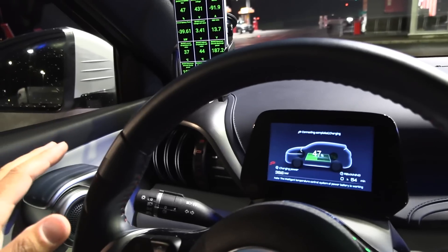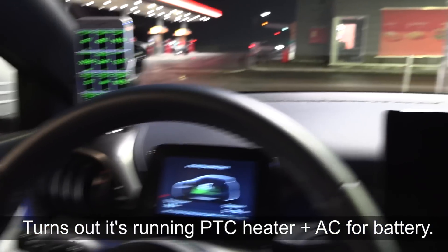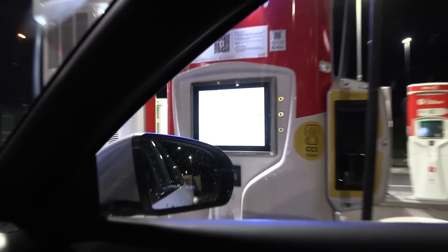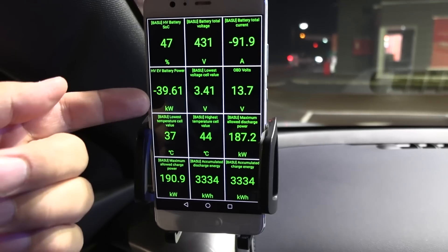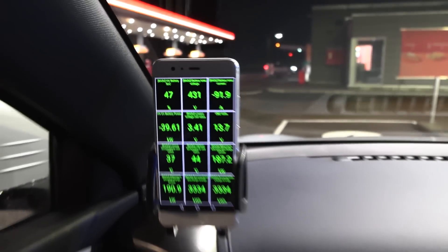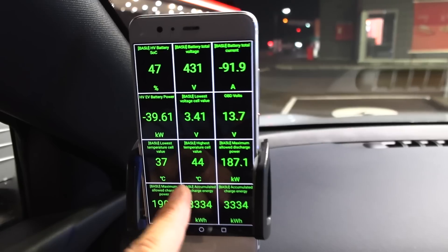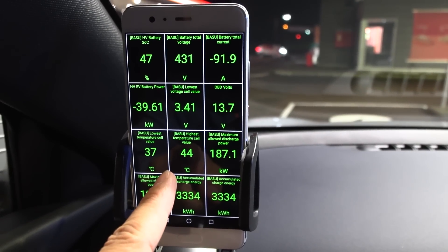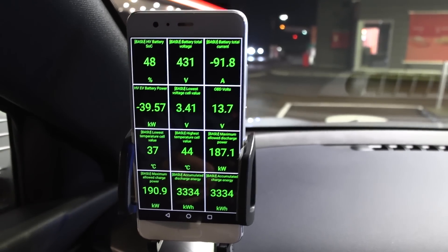We're back. I noticed that it's quite hot in the car now — it seems the car dumped some of the heat into the cabin. I noticed this also during the 1000 kilometer challenge. Now we're pulling 44 kilowatts from the charger but only taking 39.6 into the battery. So we are now cooling at the maximum rate, which is roughly 4.4 kilowatts. But it took a while. Now we're finally at 44 degrees Celsius and we should get 85 kilowatts again soon.